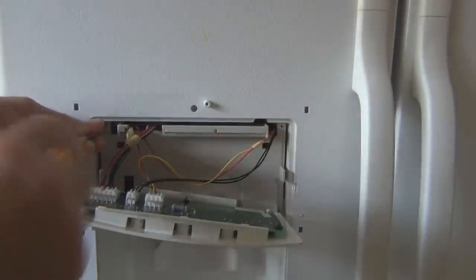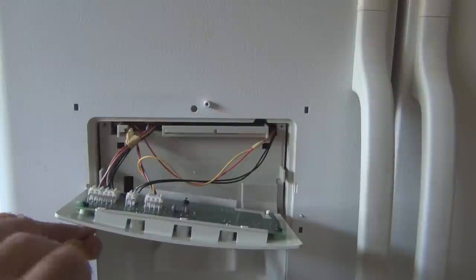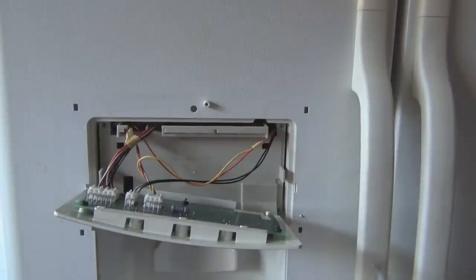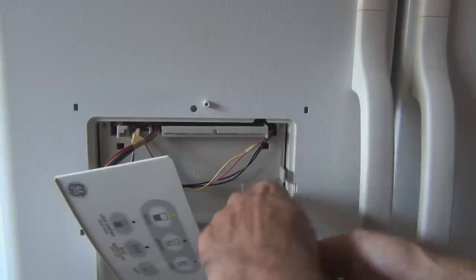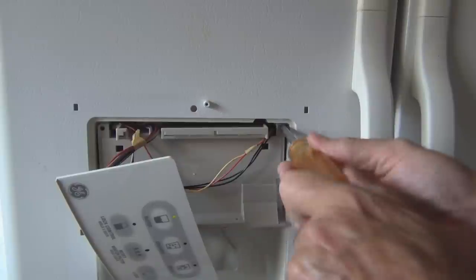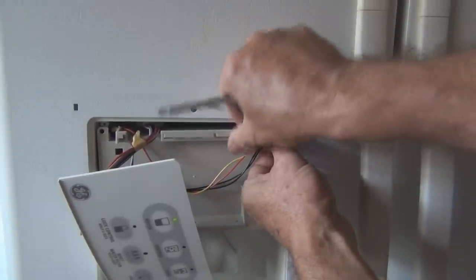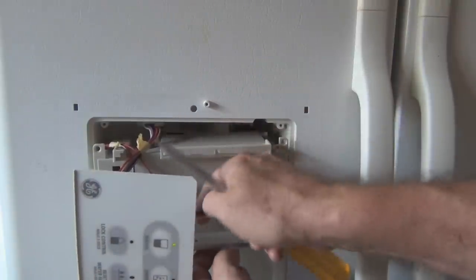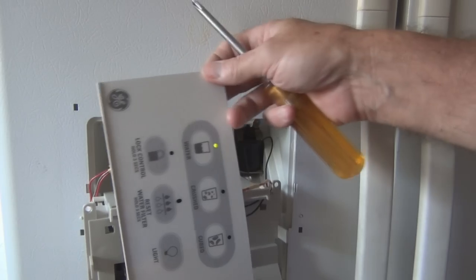But you also want to remove this panel here. It's recommended to put some silicone caulking around the water tube that comes out through the freezer door. I've also seen videos where there's some foil with insulated foil backing that you can install a sheet of on the inside of the panel opposite this water dispenser, on the inside of the freezer. I guess that cuts down just enough maybe on the cold air on the door to also prevent freezing. So this comes off. Let's see how that feeds through there.